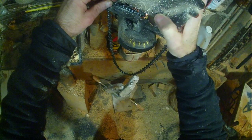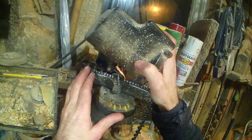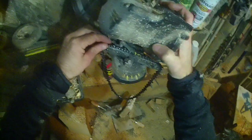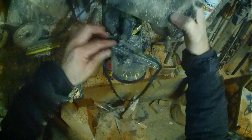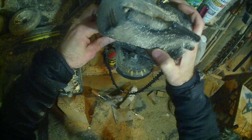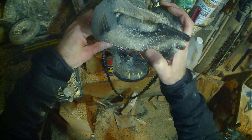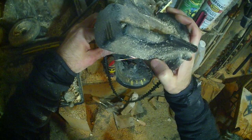I use this tool, I don't know if you can see it in there, I use this tool to lower the bite and to open the bite and to get the same angle on the chain. That's about all I use it for. That's why I call them scuffs, because basically I'm just real quickly going through and scuffing the chain. I'm not really grinding hard.